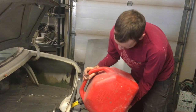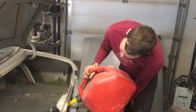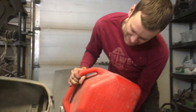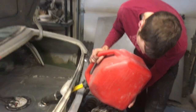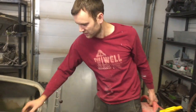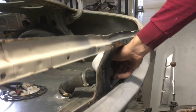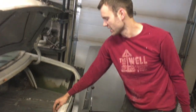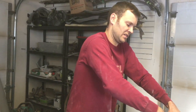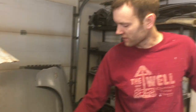First of many tanks! It's custom welded and I don't know if he pressure tested it or not, but the guy's pretty confident. I can smell the gas already — there's a lot of pressure in this thing. You blocked off the vent tube? It doesn't actually need it — if you look at the cap, there are little cracks in the rubber on the cap so that'll vent it. The vent ends up in here, so if we have to use it we'll just run it into this fuel filler area. My dad has a '70 Nova — when it's all the way full it shoots out of the back of the cap — and this one will possibly do the same thing, although the neck design is different.